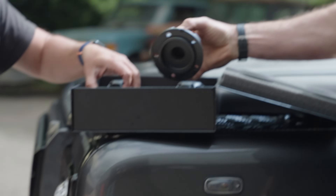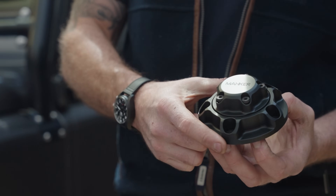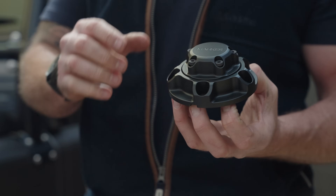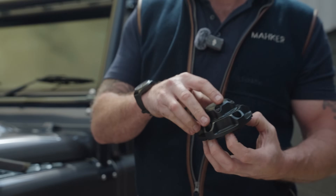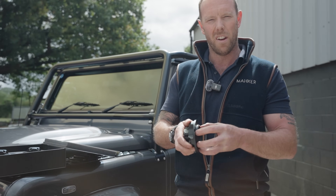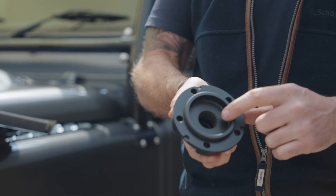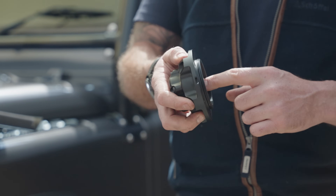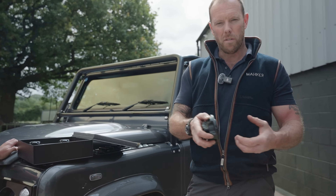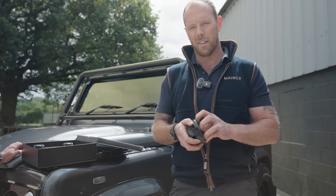After designing these drive flanges with a good friend of mine, we came across a tolerance issue. The drive flange is made to a very high tolerance — we don't want any slack, as many of you will be familiar with the clunk-clunk-clunk that Defenders give over time with wear and tear, so we made the spline even tighter. But when we went to fit this onto a heavy duty CV joint made by a good UK manufacturer, it wouldn't fit — it got stuck. Stay tuned and I'll tell you exactly why it didn't fit in the next episode.